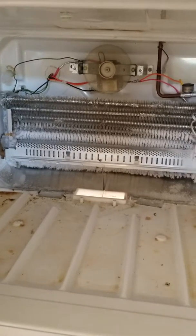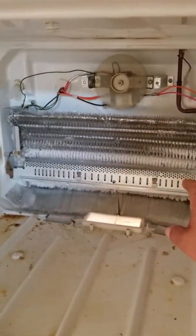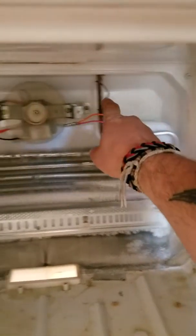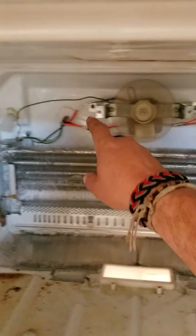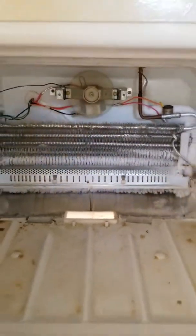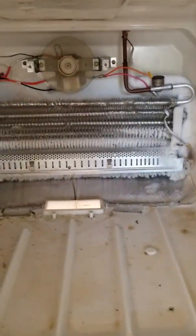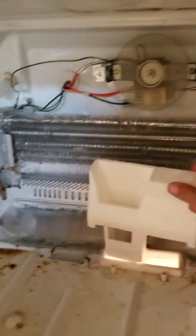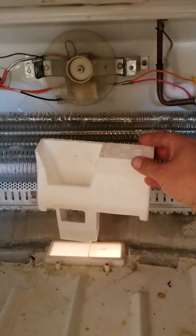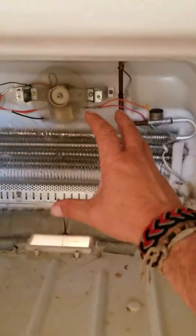To figure this out, you're going to want to take off the back. There's one screw up there, one screw over there, and two screws right there. Take off the little chimney in the very back center. Once you do that, you're going to want to take this foam out very carefully, because this is what feeds the cold air down into the refrigerator.